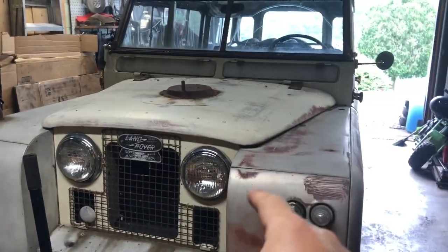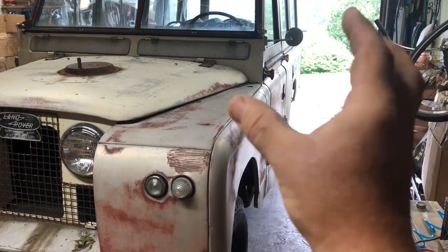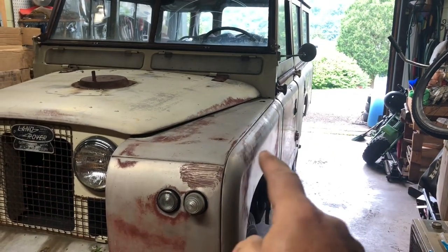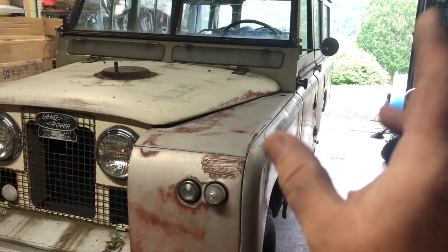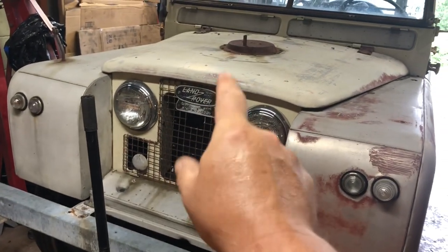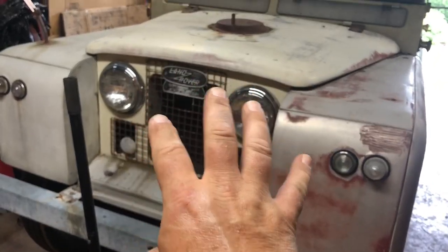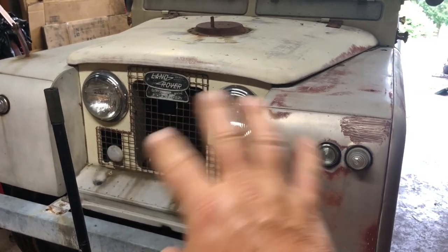So, recap. The girl's in here. She's ready to go. So the first thing, I'll probably work on the differential in the back so I can take that out, clean it up, and get a replacement one. And I already have a replacement rear diff lined up. But we may try to rebuild it too, but that might be a future one too. But these are all future videos. The rear axle's getting fixed. Timing belt, that's going to be done. Not timing belt. Timing chain, we're going to take that apart, do some measurements, check out some parts, and see what's going on with the timing on the engine. I still don't think it's advanced. It won't let me advance the timing anymore, so she's weak.